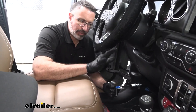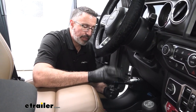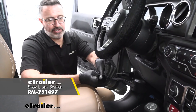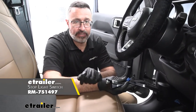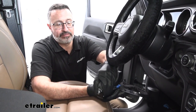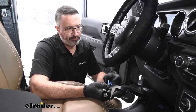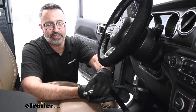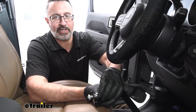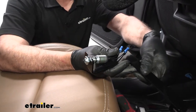Something you need to know: if you have a Gladiator and you're looking at the Demco Duo system, you will need a brake light switch. This is a separate component and you need it. It consists of a bracket and a basic pin switch. These mount pretty easily, though the setup takes a little time. You've got some set screws and you need to make sure these get set correctly, but mounting it is fairly straightforward.